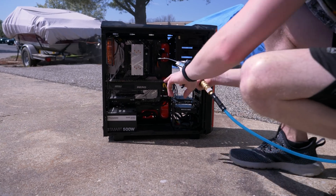So what we're going to do now is take this cooler off — pretty simple to do. Just take these little fan brackets off so we can actually unscrew this thing, and then we're going to reapply thermal paste, which as Jackson mentioned is very important to do, and probably clean the inside of this fan a little bit. Microfiber is definitely one of your best friends when cleaning a computer — you don't want to use paper towels or anything abrasive. The thermal paste isn't that bad as you can see, but it could definitely use a touch-up. An 8700K does run a little bit toasty.